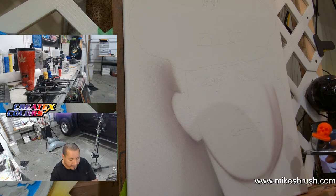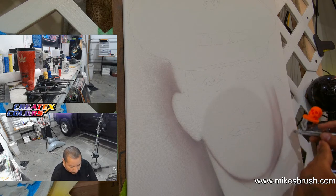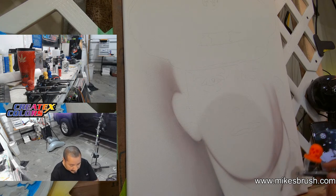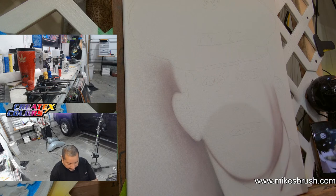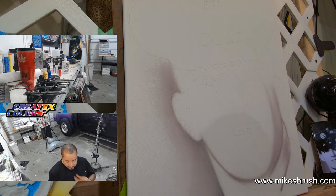Some plastic, no matter how you degrease it or promote adhesion, is not going to stick. There are plastics that are designed to be slick. That is their whole purpose. I've had people bring that in, and I have to explain and show them the plastic number. I tell them I could paint it, but it doesn't mean it's going to stay. So don't hate me if it starts rubbing off, or you get a scratch and part of it starts peeling up. I'm letting you know up front that it might not last because it's that particular type of plastic.